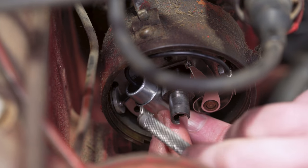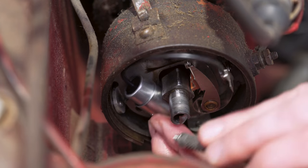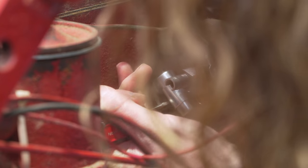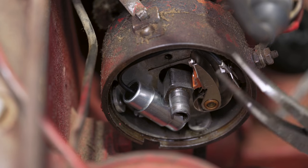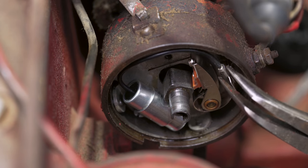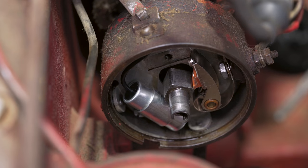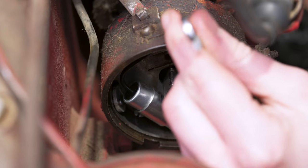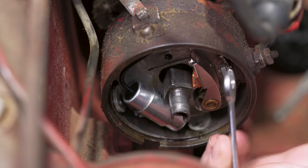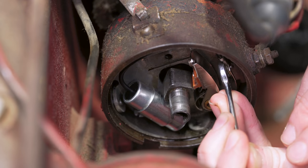I'm going to work on the condenser strap first and get that screw in the right spot. With the condenser screw tightened up, the next step is to get that wire into place where it should be. You can just grab on to it here with a pair of pliers and pull it up and into place — see how it just slides right on there. Then with everything lined up where it should be, you can use your little wrench again and tighten this nut up all the way as tight as you can get it, because you want that to be really snug and secure.